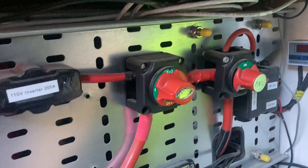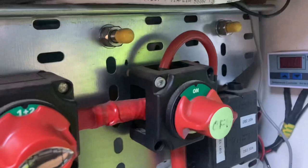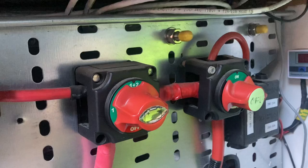This one on the right is the kill-all switch — this big red 70mm square cable is the feed from the leisure batteries to everything else in the back of the van. If there's any kind of problem I can turn that knob and kill the whole lot, which I'd really highly recommend. An electrical fire in a van is unthinkable, so just be safe — and everything should be fused too. I've got a fuse on the output from the charger.